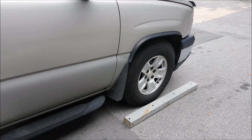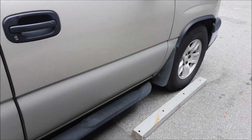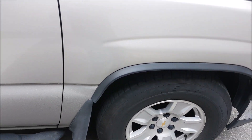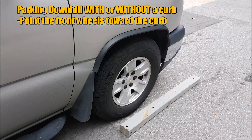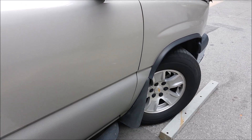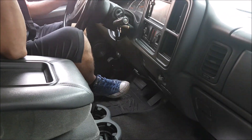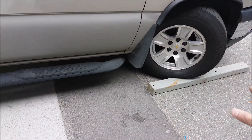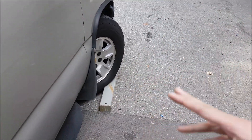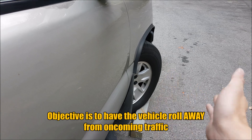Now the vehicle is facing down an incline with the passenger side closest to the curb. We'll simulate in neutral and let it roll forward — confirmed, vehicle rolls forward. Now we turn the wheel toward the curb, go to neutral, let go of the brake slowly — no brake application, all the weight is held by that tire as we roll into the curb. If there were no curb, it would just go into the ditch or off to the side.